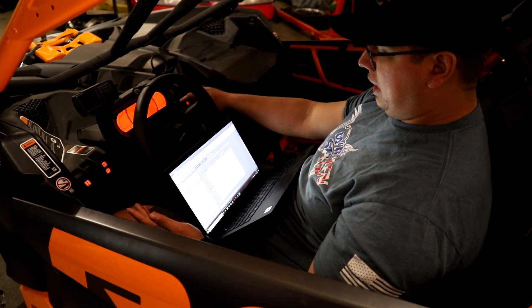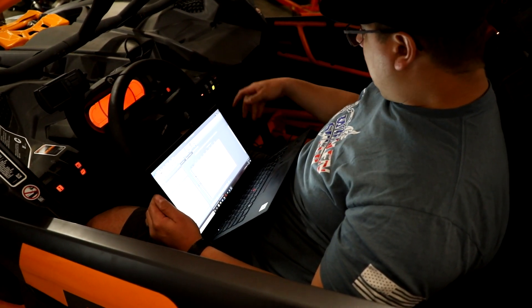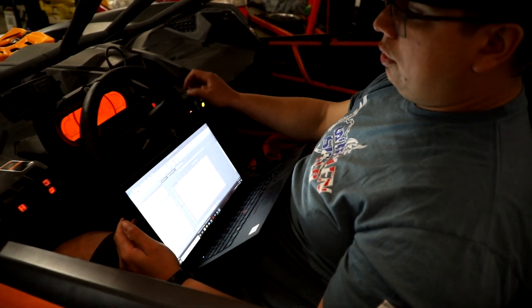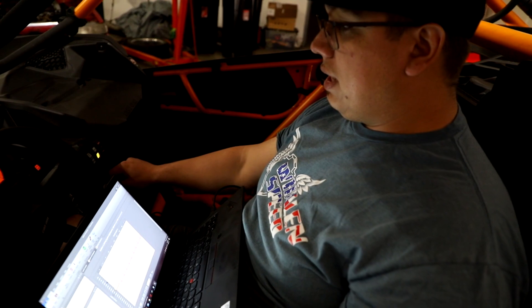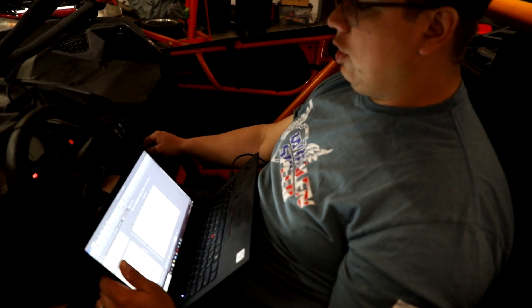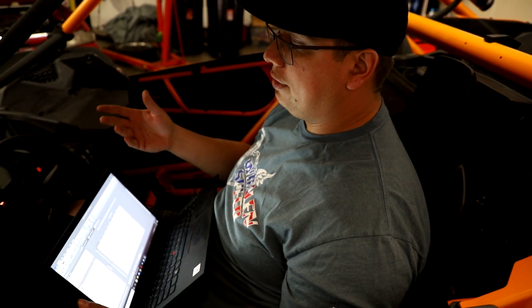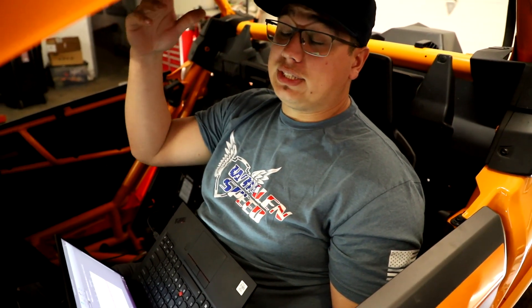So I'll do a demonstration — I'm not holding a brake or anything, just pushing the button. When you set up launch control, you preferably don't want the clutch engaging the belt on the two-step. When testing in your garage just rolling up to engine speed, you might think it's 2700 RPM, but because the engine speed moves around more violently on the two-step, the belt might start to engage at 2600 or so. You may need to play with the setting a little bit.